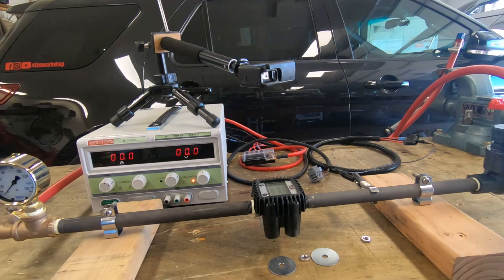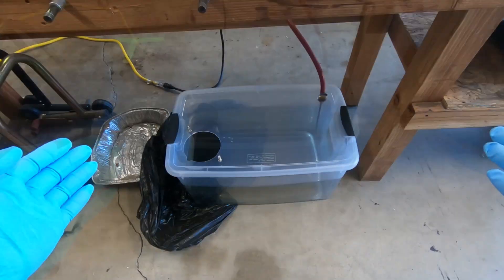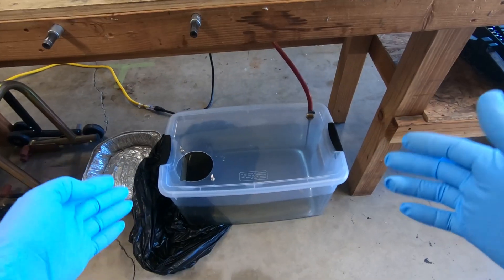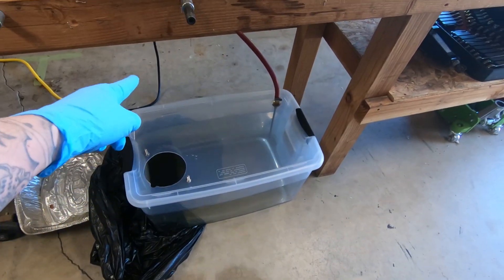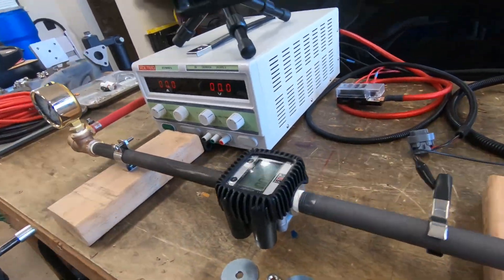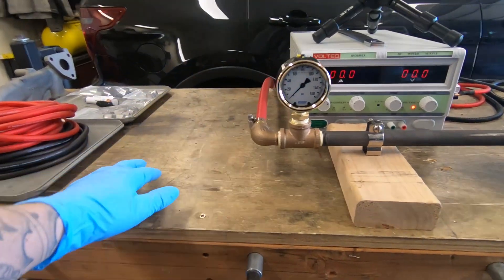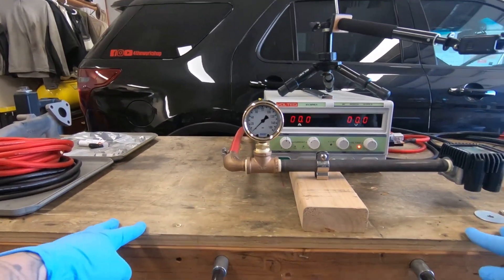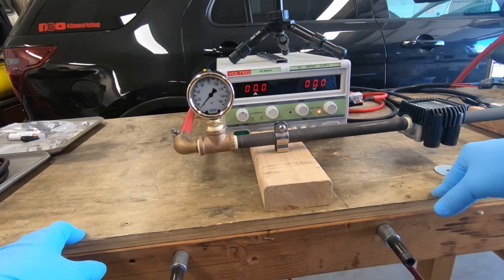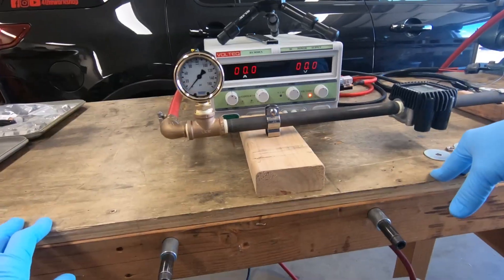This is essentially the test rig, and this is the beginning point of the test — a tub that holds 15 gallons of E85 that I'm using. The pump goes in there, pushes the fuel up into the test rig, and flows to the entry point where we've got a pressure gauge. This pressure gauge reads from 0 to 160 psi, and I'm testing from 50 to 100 psi in 10 psi increments. This platform in the vehicle can see up to 110 psi in some readings.